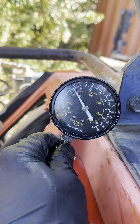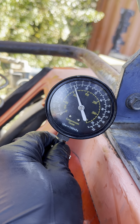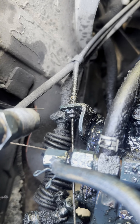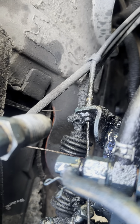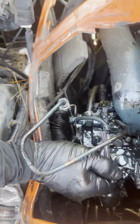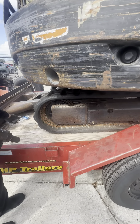As you saw in the previous clips, we checked compression with our finger just to make sure, and the reading we got was about 110 to 115 psi — so it did have compression. We finally got the injectors to fire as well. Everything was checking out; the compression was a little lower than we thought but pretty good overall.